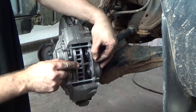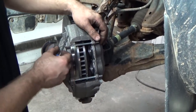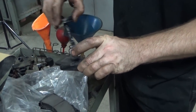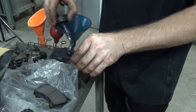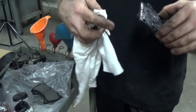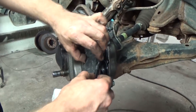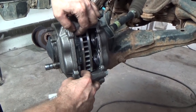Okay, so take this, move that clip like so, and we're out towards you. This has a dual piston caliper, so we know we've got to put a little grease here right about where that piston is going to land. What can happen is that dirt will collect, so I usually put a small film. This one does not have a squeaker on it, so that'll go in there just like so.